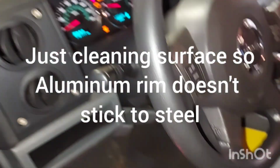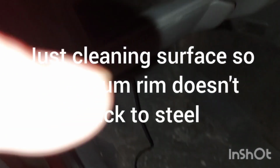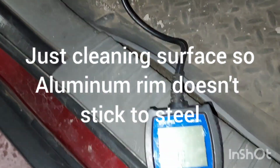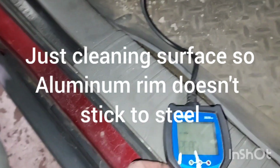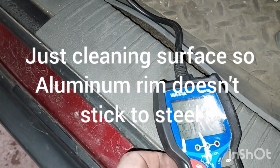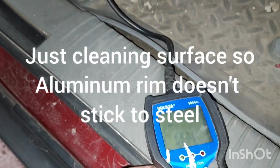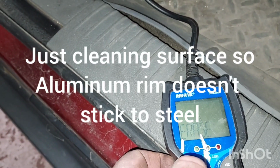I'll be real careful. I'm taking a risk here. I got it just on a jack on the differential right now, but I do this all the time. I'm a paid professional. Okay, 457 is an emissions code. I'm gonna go to ABS. It's gonna say C1044, which I mistook on the last video. I kept saying that C1044 was a brake switch code. No, it was the tone ring: right rear speed signal malfunction. But it all worked out. My brake switch is brand new and perfect now. I'm going to clear this 1044 right rear speed signal.